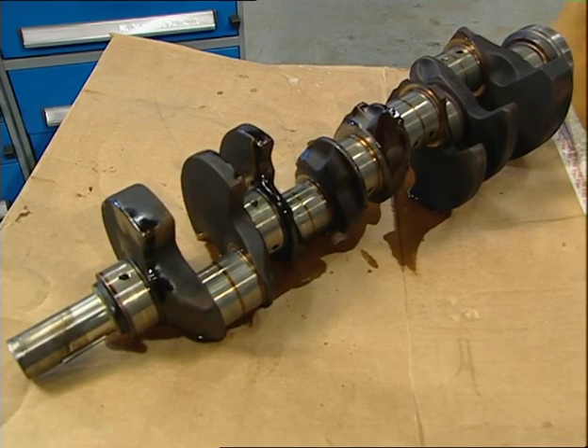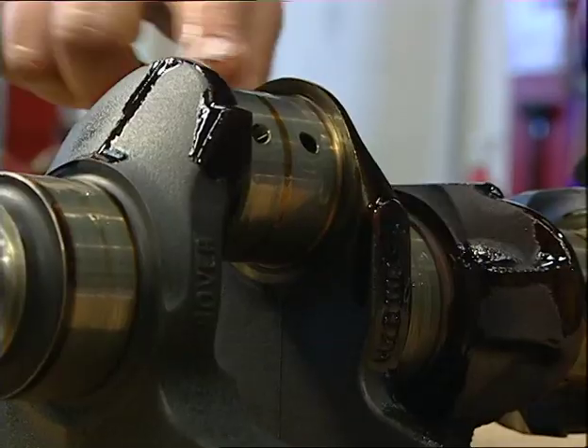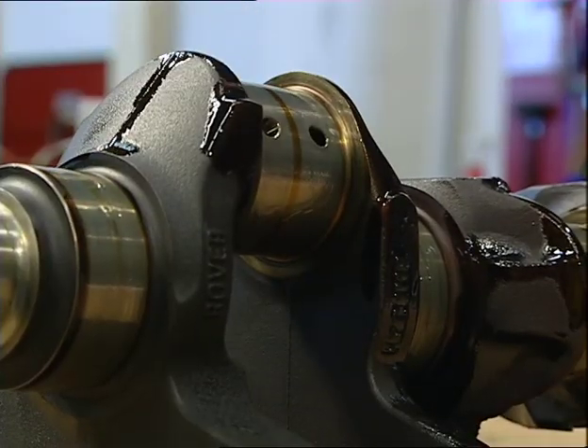There's your tip — now we're going to put in a crank. Here's the crank, all cleaned up — same job as the pistons, put in the degreaser overnight and then all cleaned up with the brush. What I've done to prep it is to put some oil through all the oil holes to make sure there's oil within the crank itself, and made sure the journals are all smeared in oil. So that stays there for now because I need to prep up the block to receive the crank. It's an aluminium block, nice and light — the rights to make this were bought by Rover in 1963.